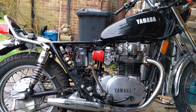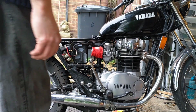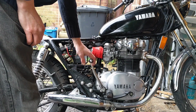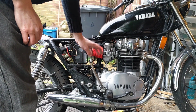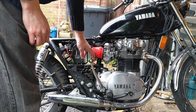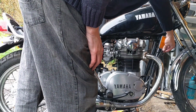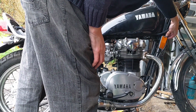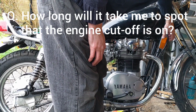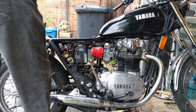Yeah, their fuel side. Oh, I don't know. Let me have a look. Let me have a go. See what happens. All right, let's give that a go. I've had the tank off. I'll put the air fuel screws back down to 2. And bearing in mind, I just checked, found the old website, and it says they're factory set at 1 to 1.5. They run a little bit lean, so people tend to crank them up a little bit. So let's see what, if any, change that makes. There we go.